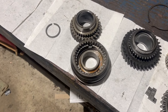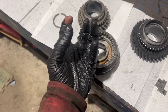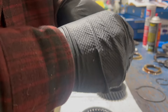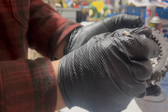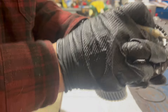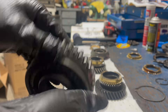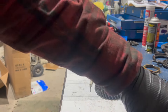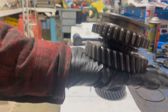The first thing I'm going to do is put these shift assemblies back together, which is a little tricky. You have to get the three tabs in there and hold them down against the springs, then slide the collar over the top. All three of the tabs, making sure I've got the direction right, a little tricky to hold these springs together. You can put them in after the fact. Took a little fiddling, but there they all are around the two spring pieces.